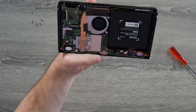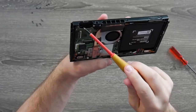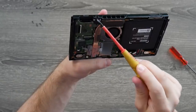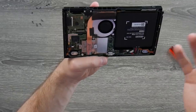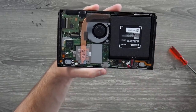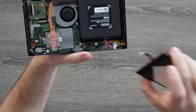Some of the other issues that could be wrong with switches sold this way are headphone jacks — headphones can break off inside, and that's actually a very easy part to replace. It's all modular; you just order the game card slot, which is all one piece, and you can replace your headphone jack and game card slot together. If there's a broken game card slot or headphone jack, that's actually a pretty good one to fix. However, this one doesn't turn on, so I have to look at the battery first — it's the easiest place to start.